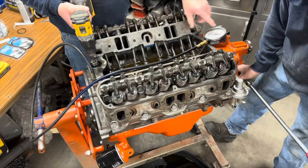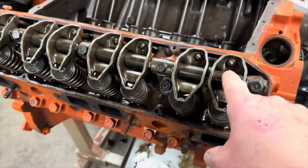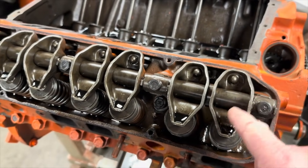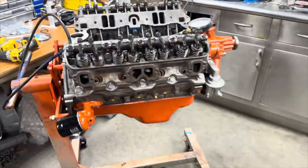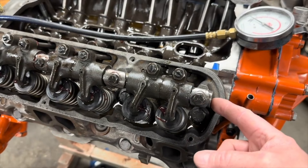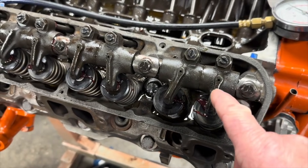The other thing you can notice is if you get to that right spot, the oil pressure would momentarily — when you pre-lube this big block — oil will literally just flow out of here like a river. It flows through the rocker shaft and comes up through here and just fills this whole cavity up, and then runs off. On these TA engines with these offset rockers, they've got spiral cuts in the shaft and you have to have these shafts in the correct way — and I know they're in the correct way.